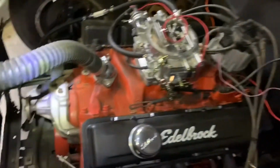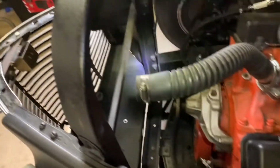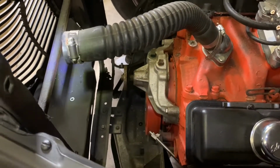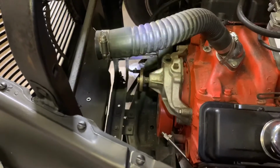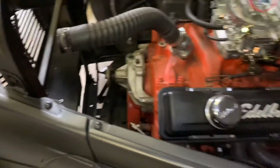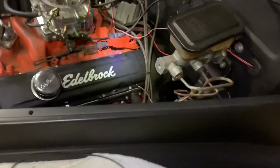I'm going to go ahead and change to a long water pump. I think I can get a radiator that'll fit inside that core support, which will give me some more room in front of that. The old radiator, which wasn't the right one anyway, didn't fit. It stuck too close to that, so I couldn't even get a pulley on it, barely. So I'm going to shift to the long alternator, I think. But we shall see.